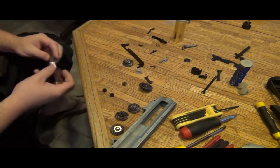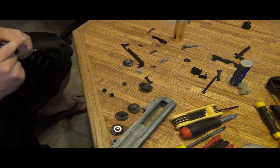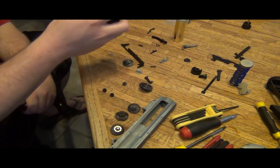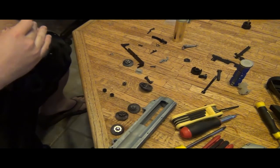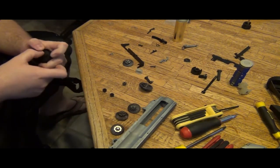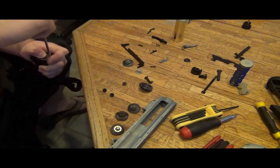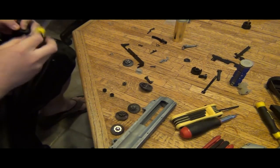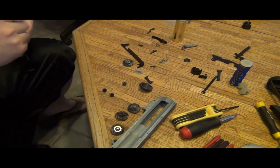Someone might say, well, you need to check motor height first. In all cases, no matter what, new bevel gear, check motor height. Well, as often as I've done this, a lot of the times, and what I mean is 95, maybe close to just 100%, I'm just making a number up here, the motor height will regardless stay the same because the gears have the same diameter. So because of that, the motor height probably doesn't need to be moved, but it does need to be confirmed that it is the same, because if you don't confirm it and you just go to shoot it, you can grind your gears or something just because you didn't set it up properly.